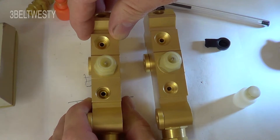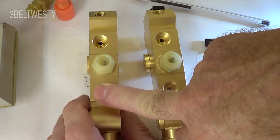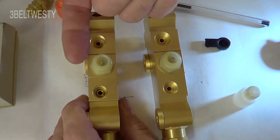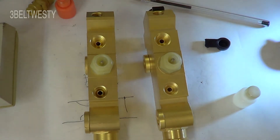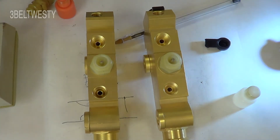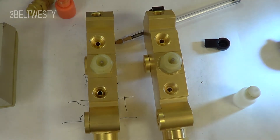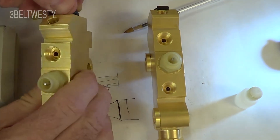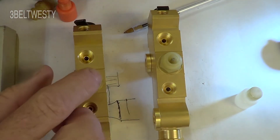The light came on and I said oh gosh, I screwed up. So today I went through and undid the rear bleeder — it's an 8mm — and with all the fronts shut off and tightened down, I put the pedal and the light went off, moving the spool back. My question is: if the master cylinder is old and dirty, you might get a spool that gets stuck to one side from crud. If they're all encrusted you probably should just go and replace one of these. I'm going to replace the lines on my car and put a new one in.